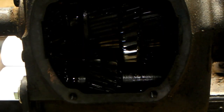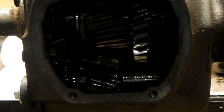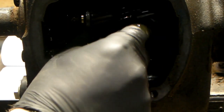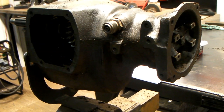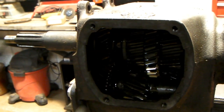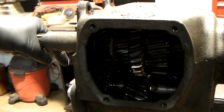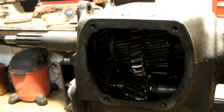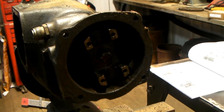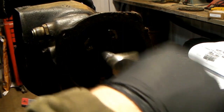Basically all the movement is being done by two things: your low and reverse gear and your second and third speed clutch. If both are disengaged, you're in neutral. Now what we need to do is put it in two gears at once. I'm going to move the second and third speed clutch all the way towards the input shaft, and I'm going to put the low and reverse gear engaged in that low speed drive gear. So now we're locked up — we go to the yoke here for the drive shaft, and now we can easily loosen that since it's locked up.